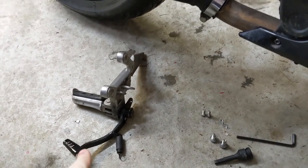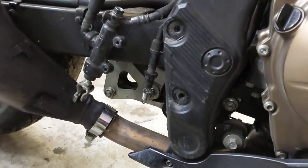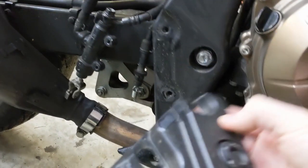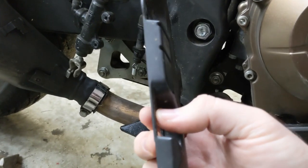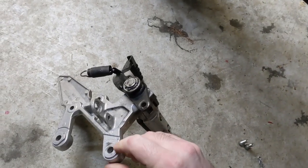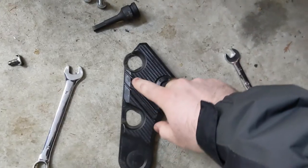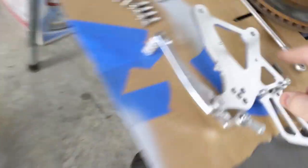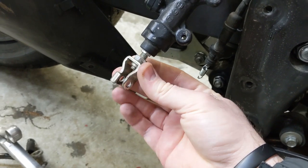Once your rearset with the brake lever is off, you can leave the large spring attached for now. Unfortunately, the plastic can't be reused because the aftermarket rearset doesn't have the little grooves to go around these pieces of plastic. You see these have a recessed area to go around the plastic, and you'd have to cut a channel through here even if it did. So once that's off, the next thing you need to do is remove this little adapter on the end of the master cylinder.